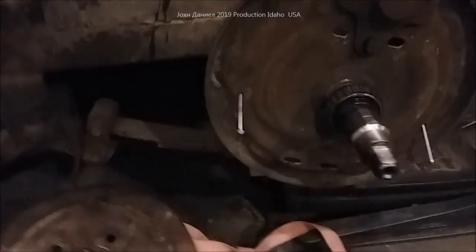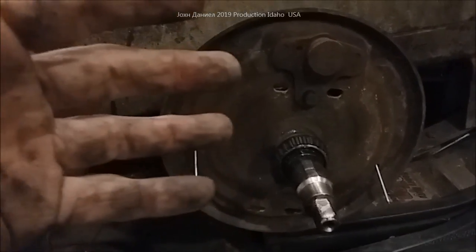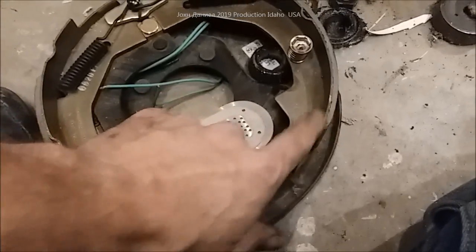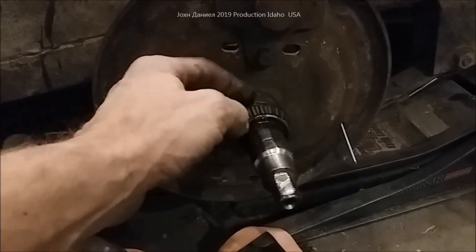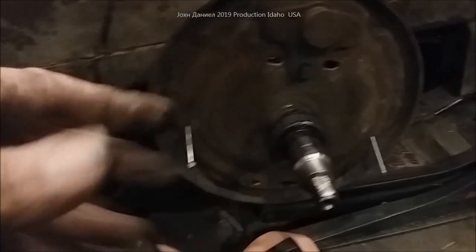What we're dealing with right now is a little bit of a quandary of design. This is a welded-on brake mount. The problem you reach with that is you just can't cut it, and you just can't drill it because it's going to give you three-sixteenths of an inch further into your hub. What that means is that these pieces here will be rubbing against your wheel. I've seen people go as far as putting an eighth-inch or three-sixteenths-thick washer, then their oil seal, and the problem with that is your oil seal eventually comes out.